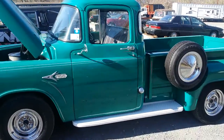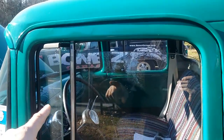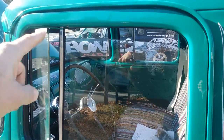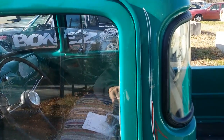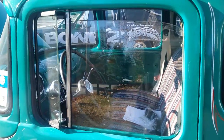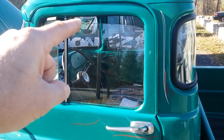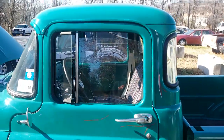The next thing we have to do is we're going to be pulling out the windows — the driver's side door window and the passenger's side door windows. We're going to replace all the rubber seals on the vents, replace all the run channels on both windows, and then on the driver's window I've got to do some fabrication work to make everything work, because right now that's as much as the window will open. So we're going to fix all that up next.